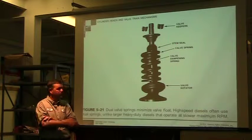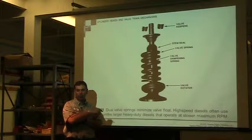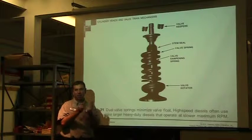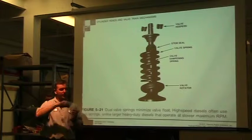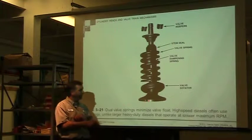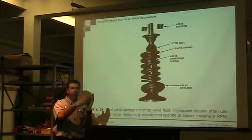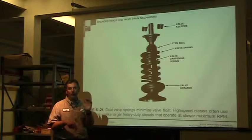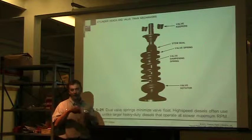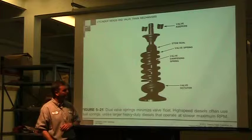We noticed on the valve itself that the gray part was all the way around the valve, because when they lapped and spun the valve, it was 100% all the way around. The seat pattern was the same because the single point of the area that it was touching touched the same area. But looking at the seat, that's where we noticed that the seat itself wasn't being touched all the way around. So we want to be careful about that, and we need to address that situation.